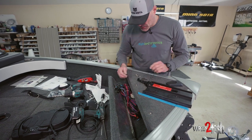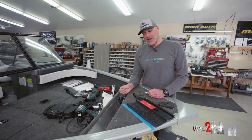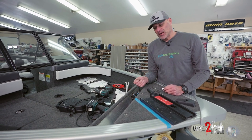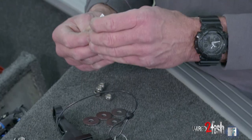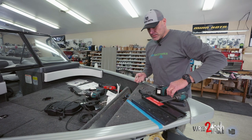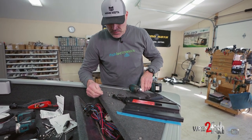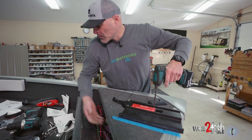The fasteners are in place and hanging out the bottom. Washers and nylocks are ready. One important tip not in the owner's manual: with stainless nuts on stainless bolts, if you use a power impact driver or hand-tighten too fast you'll get galling — the nuts and bolts seize and you can't get them off without breaking them. The simple remedy is to put a little anti-seize on the bolt threads or fill the nylock with anti-seize. Then start each washer and nylock, tighten until the nylon engages the threads or you can no longer hold it, then finish tightening.